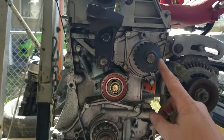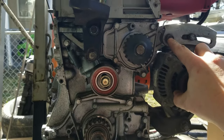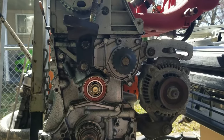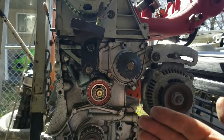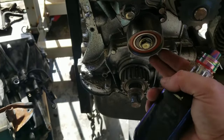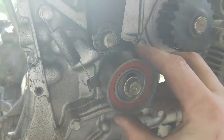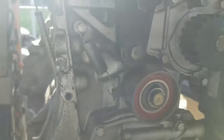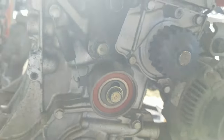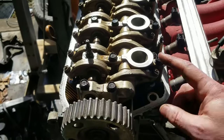When you do this, you should always replace the water pump — it's only four bolts plus a fifth, and you'll need to remove the alternator bracket. It'll save you a lot of trouble in the long run since you're already this far. You should also always replace the tensioner because it tends to wear out. The tensioner has a spring that connects here and to the bottom — it's important to keep that connected.